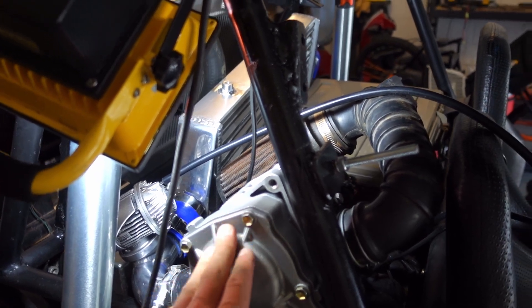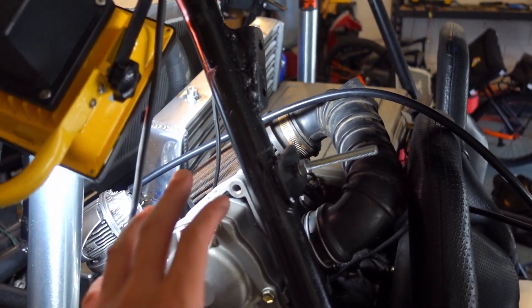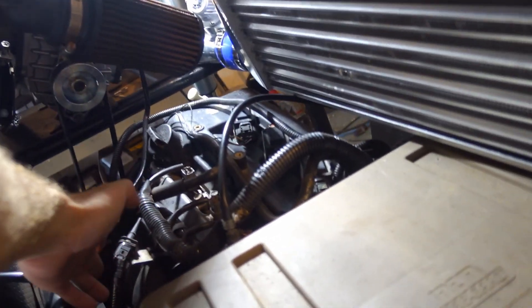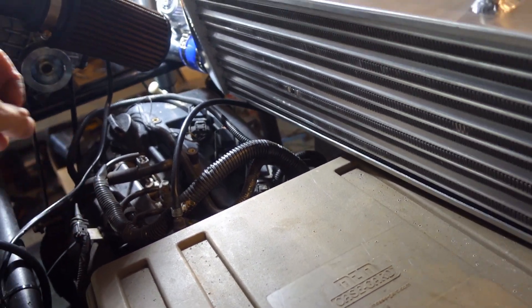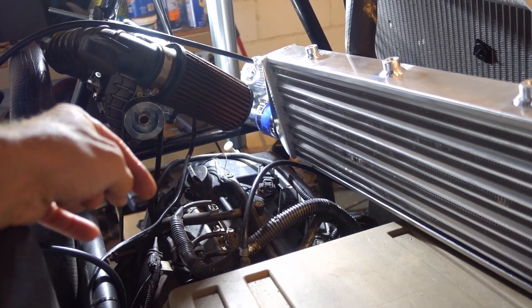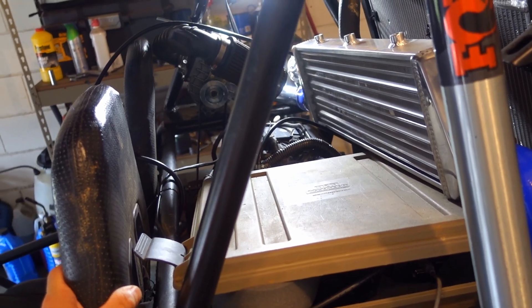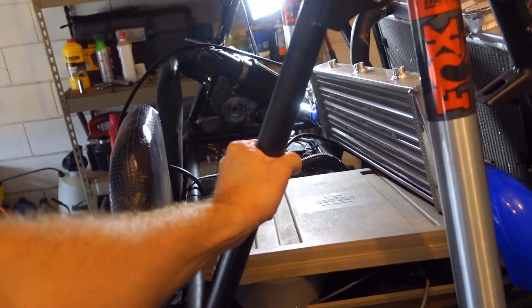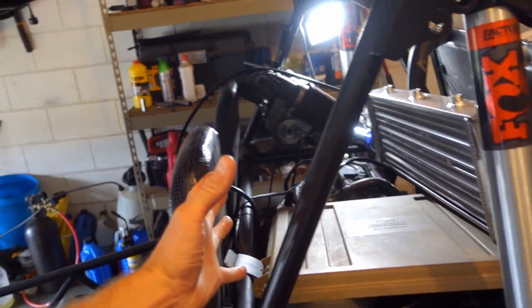At the end of the day, I don't think I'm going to be able to run this, because it's going to absolutely require hearing protection every time I bring it out, which is a big downside. So far, fuel pressure seems to be okay. There's quite a bit of headroom in these injectors — on these Mitsubishi Mirage engines, the injectors are rated to about 220cc, so there is about a 25% to 30% headroom with those injectors, which is great for this kind of setup.